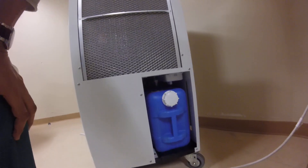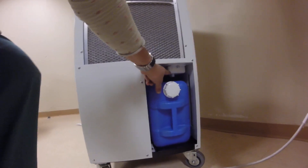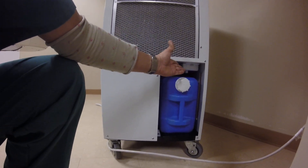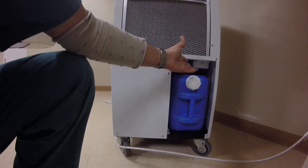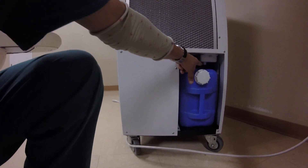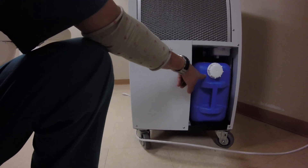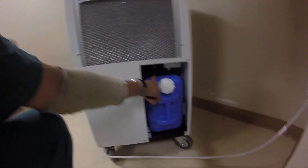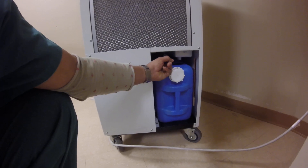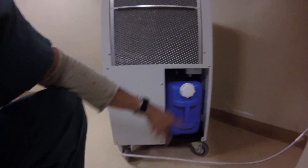There is a little spout, and you can see the drops falling. The condensation falls onto this plastic and inside is a styrofoam collection tray. There is a little hole and the spout drops water into it. Once the water level comes up about that much, this little plastic float comes up and shuts the machine down — so it cuts off. That way it won't overflow everywhere.